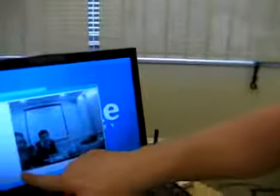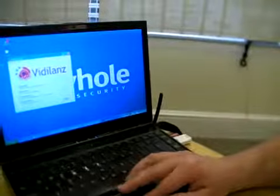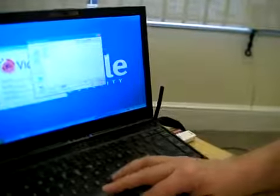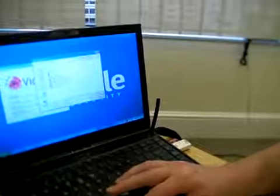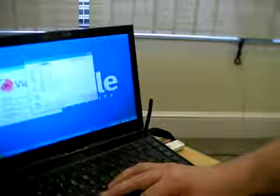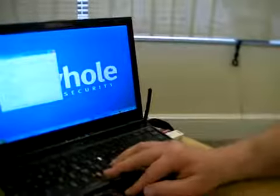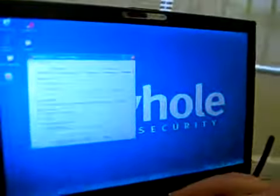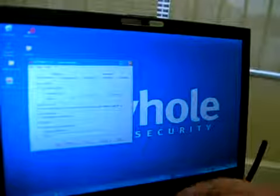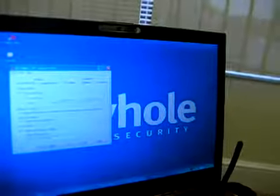As you can see from the watermark there is a date and time which is a default, so we are just going to change that now. We do that by going into configuration, continue, my computer, removable disk, settings file. This is the settings file which has now picked up the date and time. So I am going to write in here the watermark — demo4info4 — and I save that.